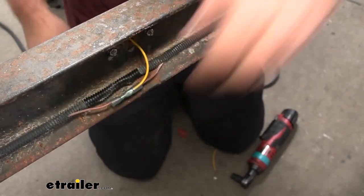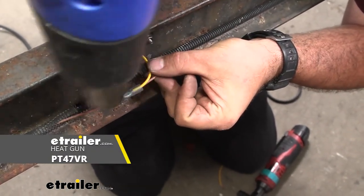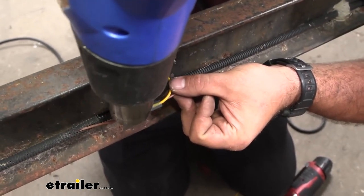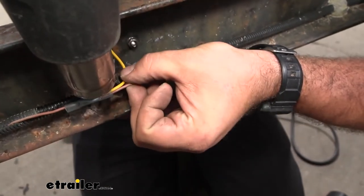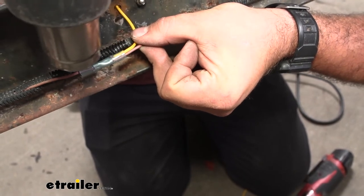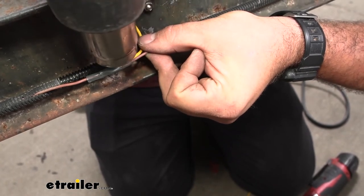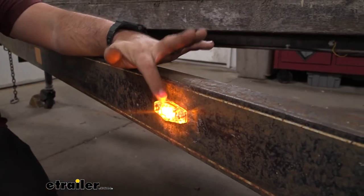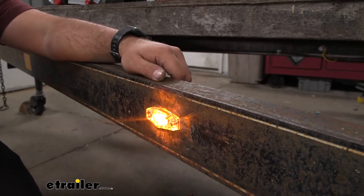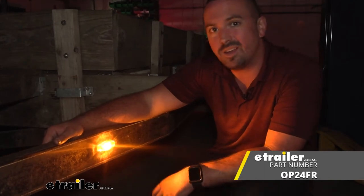Once those are crimped down, I'll go ahead and get my heat gun. Just be careful not to get your wire loom — kind of work the heat back and forth. If you don't have a heat gun, a lighter actually works pretty well. As you heat this up you're going to see it start to shrink around, and that's going to create that watertight seal. This is why they're super beneficial, especially in spots where the trailer could be exposed to weather, which in this case it absolutely is. All that's left to do is test to make sure it works — you can hook up to your truck or a test box and turn your running lights on and they should kick on. And that was a look and installation of the Optronics Mini LED Side Marker and Clearance Lights.